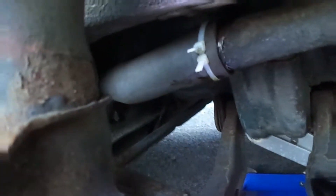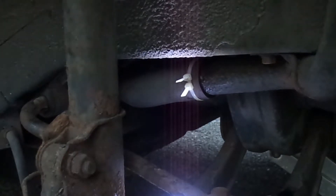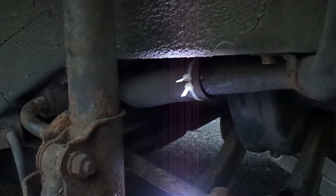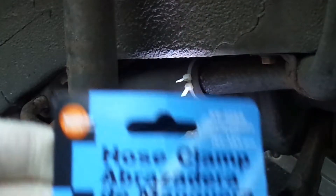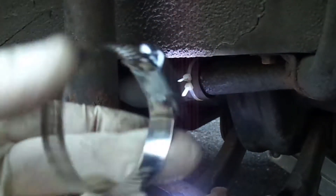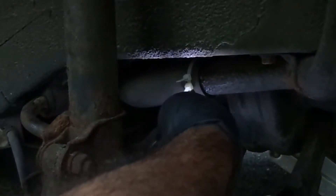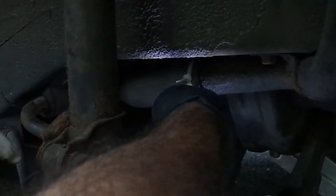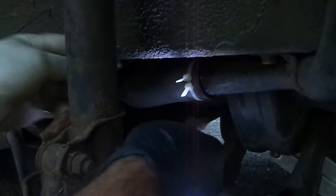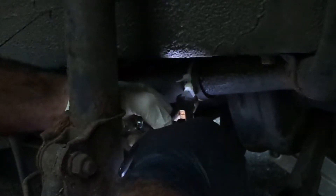I'm back and I bought these right here from AutoZone — got the clamp that broke. So we're going to have to cut the old plastic fastener off. When you cut it, just be careful that you don't cut the hose. I don't think it's a good idea to use those plastic zip-tie fasteners to hold a fuel hose — you just want to cut it off.